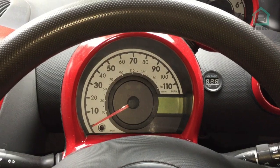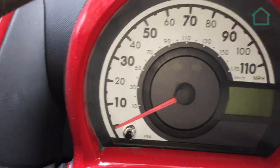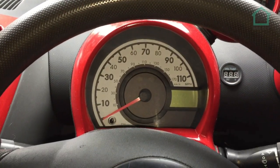What we're going to do today is take the clocks out of the car, rip them apart, change the orange surface mounted diodes to red, change the little fascias on the speedometer and the rev counter for the new ones, and then put it back together and see how it looks. So what we have to do now is remove the clocks entirely - there are a couple of screws either side. We'll remove those, take the cowling off, and then revisit it.